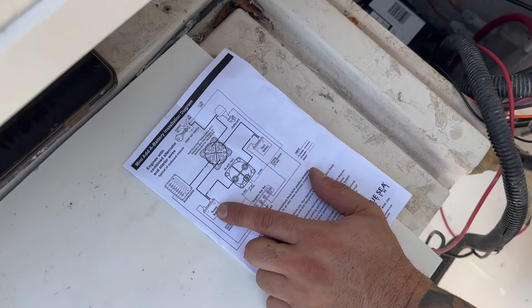We already did the house battery cable that goes to the ACR. Now we're going to put in the start battery cable — connecting from the start battery to the fuse to the ACR. These two fused positive cables run from the batteries to the ACR. Now we're going to connect the start battery to the switch terminal, which is going to be mounted up here.